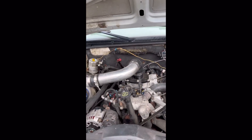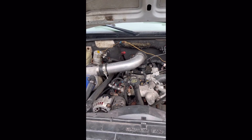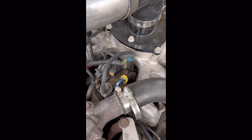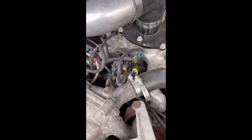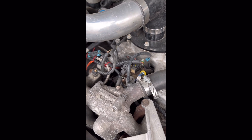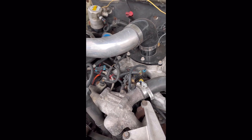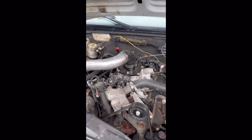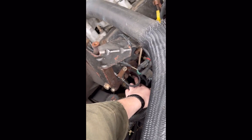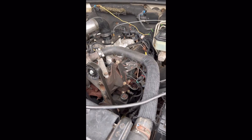Step one: you can do the Feed the Beast mod on your fuel filter head — you can kind of see the fittings down below there. Here's the Beast on the injection pump side for DS4, that's '94 to 2000. As far as my knowledge, they do not make one for a '92–'93. You can get upgraded fittings through either Leroy Diesel or Diesel Site, but Leroy has a nice little upgrade for that.